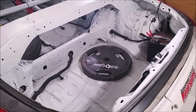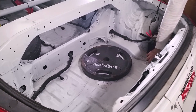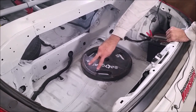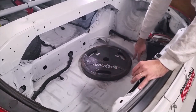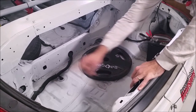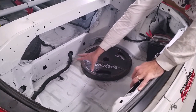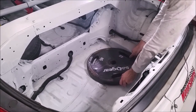I took a peek under the car and I can see where the battery box bolt goes through the floor. I can only go over two or three inches before I hit a little cross beam where I can't get to the inside. That lines up with where the spare tire was held down, so there's some bracing there. The rear differential is down here in the middle, so I do have room above that - I just have to make sure I don't drill into any subframe mounts. I'm going to start with the plate about here.